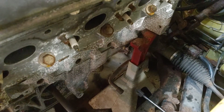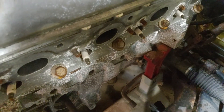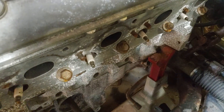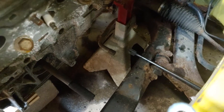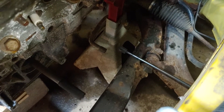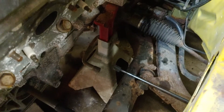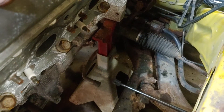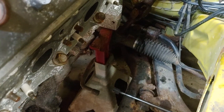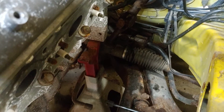Once I get this block locked up into place I'll throw those on, and once I can lift the car up with the engine in place I can get a better look underneath. I don't see much chance that this K-frame is staying — I think there's going to be too many compromises to try to leave that in place. Unibody is pretty stout and unless I'm getting into some real mondo horsepower, I could probably live without putting a full frame on this car, but I think that's probably the way to go.